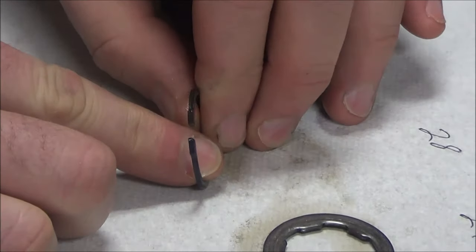If you're too thick or too thin, something's going on. This one is real obvious with the physical damage. What caused that ring? It bent over against the side of this. So when I see this problem, I also get really concerned about the straightness of the pin itself. This granite block is what this is really good for — I can take and actually see if it's bent. I'm going to see if it's wobbling. A more accurate way to do that is with what we call a set of V-blocks.